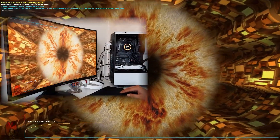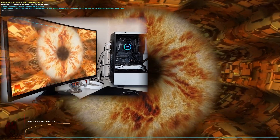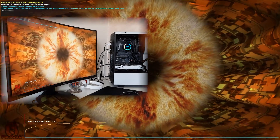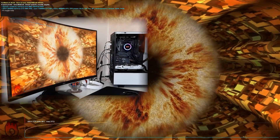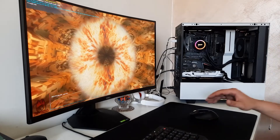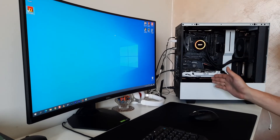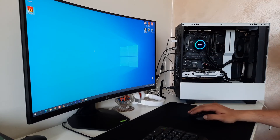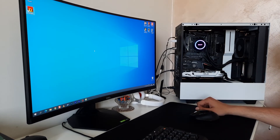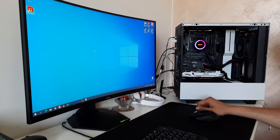After five minutes we are at 77 degrees — it was 76 and it is very stable. When we first tested it, at the fifth minute it was like 80 degrees. So after changing thermal paste I got like four or five degrees down in temperature. You know what to do — change the paste on your GPU if you have the same one and you don't know how. That is it for today's video, thank you very much for watching. Leave a like, share this video, help people who need help with their GPUs and IT tutorials. This was your Chicha and we are going to see you in the next video. Until next time, peace!